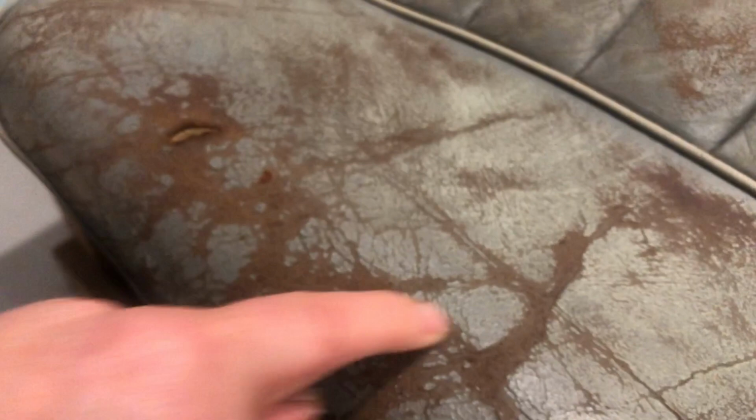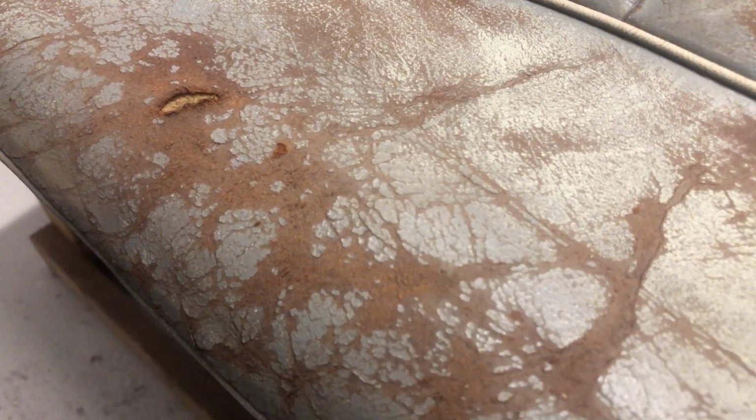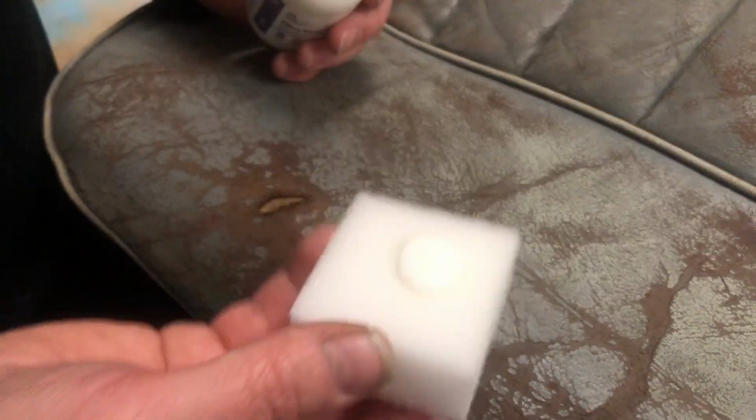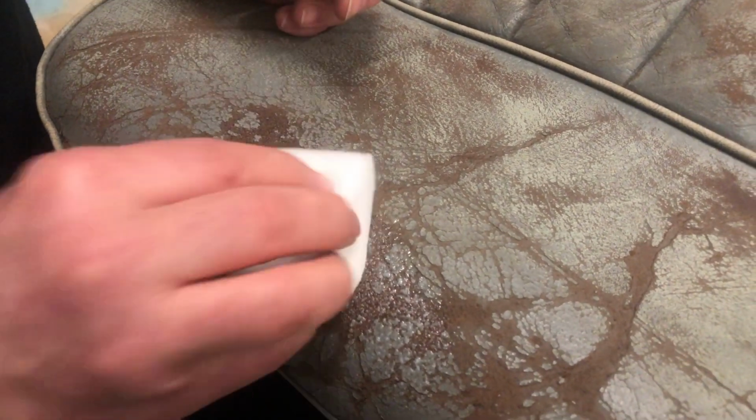So obviously with your fibre binder, we put it in with a sponge, and that's going into all the areas where you've got a lot of fibre structure that's broken, like we've got here on the seat all the way around. So we need to get the fibre binder in there, which is LRC 24. We call this a watery filler glue. As you can clearly see, it's very, very runny. You're just going to sponge that on and let that soak in. A really good coating. This will probably want a good couple of coats to soak in.